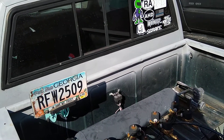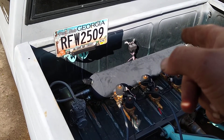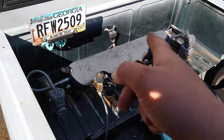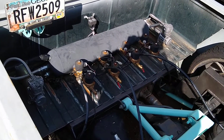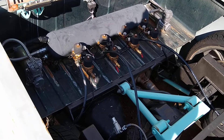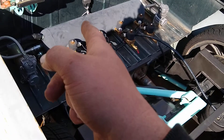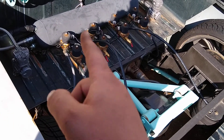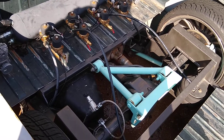I hope this helps you understand how this stuff works — it's not complicated once you know what each individual part does. Main power from the battery goes to your relays; from the relays that power goes to each compressor. The pressure switch turns the relays on and off to energize your compressors and fill your tank. Each solenoid is operated by a three-position rocker switch — center is off, up is on, down is on. Push up, you energize the fill solenoid through the T to fill your bag. Push down, you energize the release solenoid to deflate and lower the truck. Hit me up with any other questions.